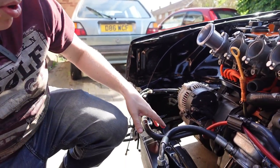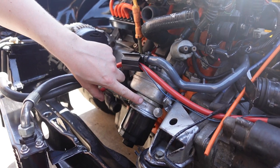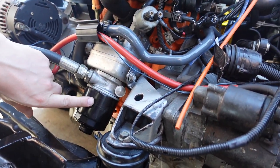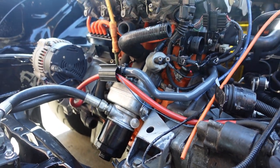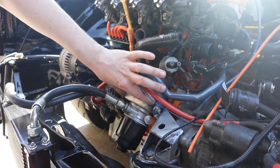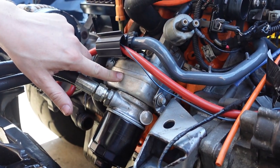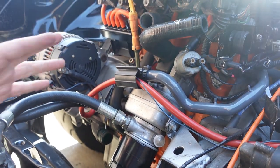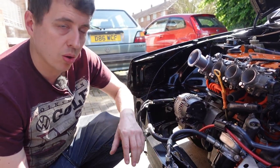So we've got the oil cooler with its thermostatic sandwich plate here. We've got something slightly unusual, a Lupo GTI oil filter, slightly shorter, which means I have to keep on top of those oil changes. And we've got the factory ABF heat exchanger, which you see on GTIs as well, in Mark IIs. So you've got the heat exchange between oil and water, and it's probably the most balanced of the options you can get. So I've got a whole lot there.